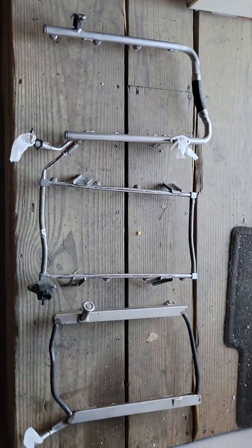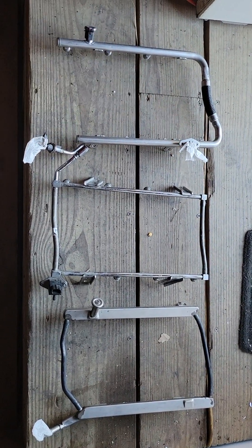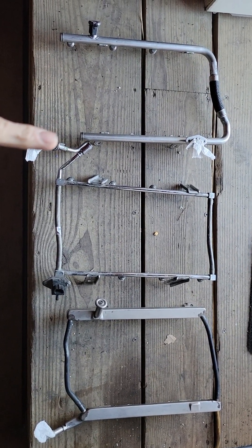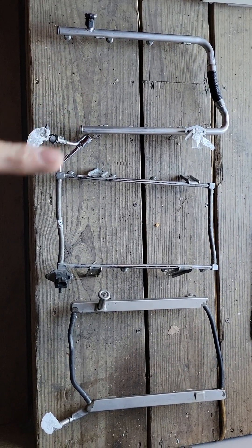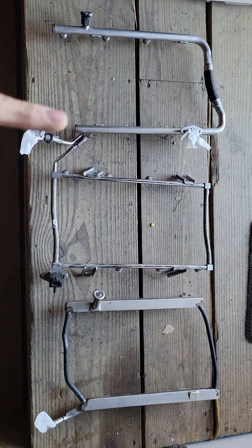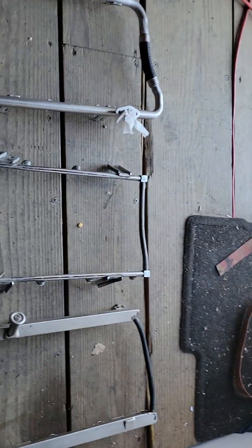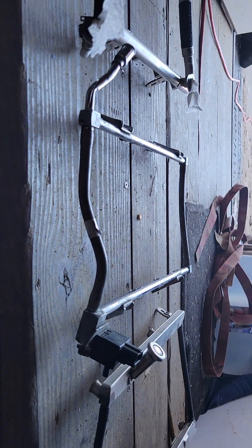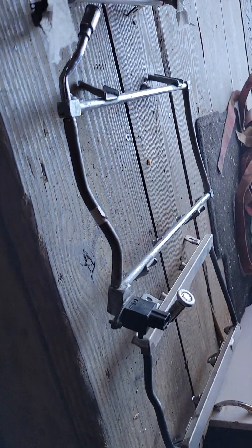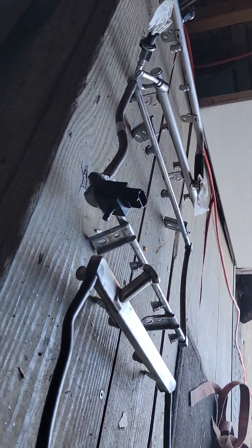Out of the three, I'd have to say I would take this one. If you're doing a Freestar intake or an intake swap, you have to watch out for your fitment on that sensor and which way it's rotated to make sure it's going to fit with your intake swap. This was the 2005 to 2008 design, and I believe these were made 2004 and 2005 as part of it. This rail has really proved to be the optimal type rail for the Freestar, and in the end it became our boost rail. Looking at the three side by side, I've found there is still junkyard gold out there that people really haven't gotten into, because that fuel rail is going to work quite a bit better for boosted applications than the Mustang fuel rail.